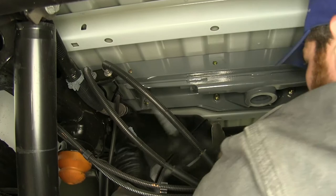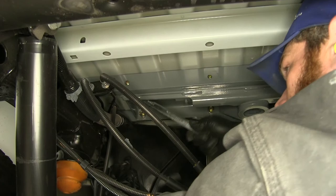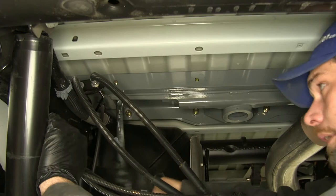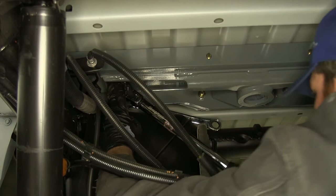We've got all of our bolts installed now, so it's time to go through and get all of these tightened down. There are torque specifications listed in your instructions and you'll follow the appropriate order. We're going to start by tightening the center section to the front and rear crossmember, then we want to square it up on each side just to make sure it's even. With everything squared up, we can get to the side plate bolts that connect them to our crossmembers.